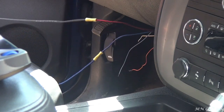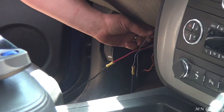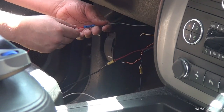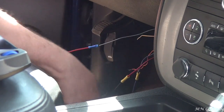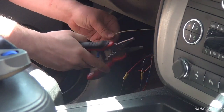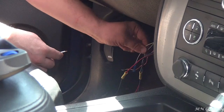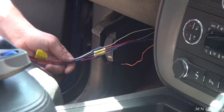The red wire on the manufacturer's side will attach to the black wire on our brake controller - that'll be power to the brake controller. The manufacturer's blue wire with the white tracer is next, and that'll match with the red wire on the brake controller. And now of course we're left with white to white. There we have it - they're all connected.